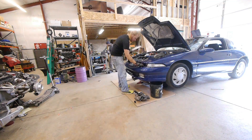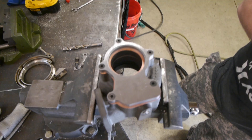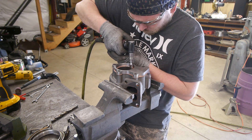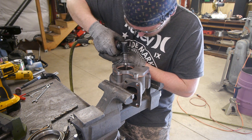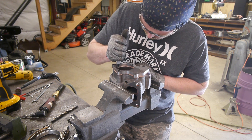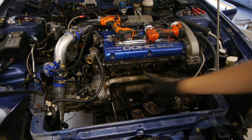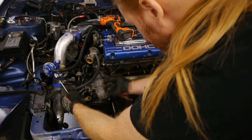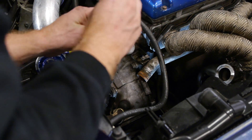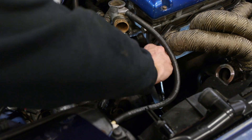Let's get that front end off. We're also going to pull the radiator out to give us maximum room. The exhaust gasket I ordered was a little bit small for our three-inch downpipe flange, so Willy made quick work of it with the grinder while I was pulling the bumper off. While he was working on the downpipe, I looped the factory turbo water lines together since we won't be using them with the HX35 — it's oil cooled only. I did that by loosening up the lines, chopping off the eye bolt connection on the lower line, and then simply running a hose between the two.